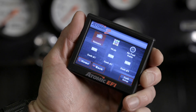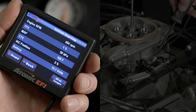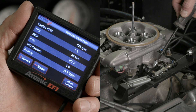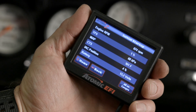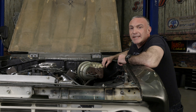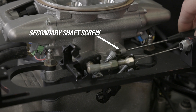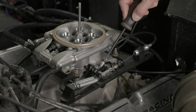Let's go back to our initial startup screen. Once the engine has built some heat — at least 160 degrees — we can go ahead and set the idle speed to the RPM we set in the handheld. With the Bronco in neutral and the parking brake set, adjust the idle speed screw closed or open until the IAC reads between 2 and 10 percent. If your TPS reading goes above 1 percent once we set the IAC, we'll need to shut off the engine and this will reset our TPS to zero. You might have to adjust the secondary shaft screw if the primary throttle blades are fully closed and the idle speed is still high while the IAC reads zero — turn the secondary shaft screw counterclockwise to close the throttle blades until your idle speed comes down. You can then use the actual idle speed screw to set your idle RPM.